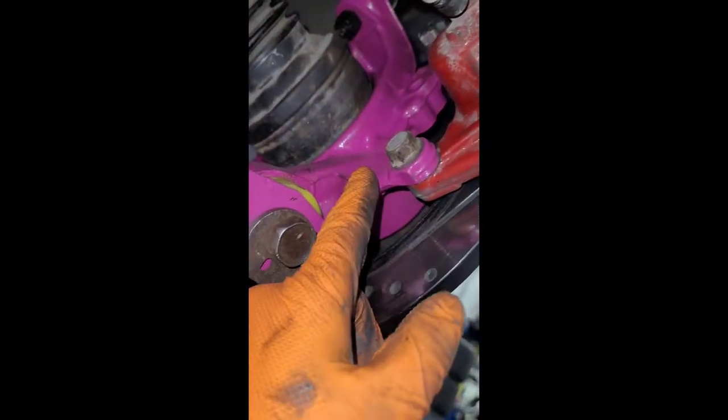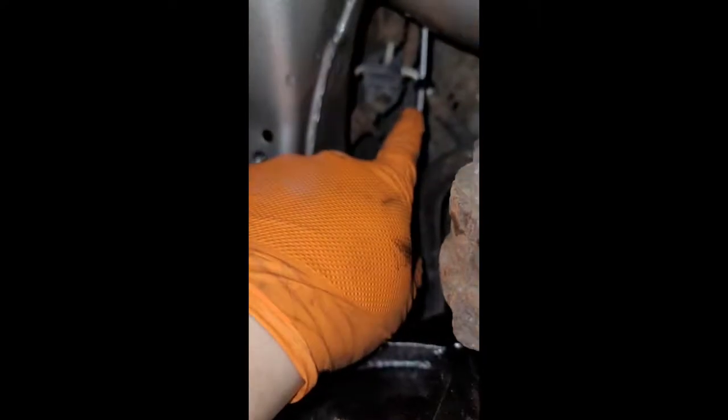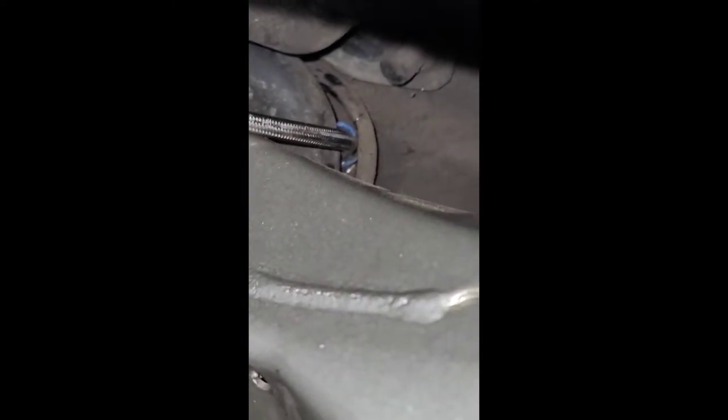Rolling under the car — this is all KFD: even matched the spindles to it. These are Siberian bushing dot CA bushings. The diff has been repainted and welded. Here's the existing evap line — we used the T on the little plastic for the evap. The brake line runs through a hole by the seat bracket to right by the rubber hoses for the evap, so there's no wear. Ran it through there and then we just have to make the bracket for the hydro brake.